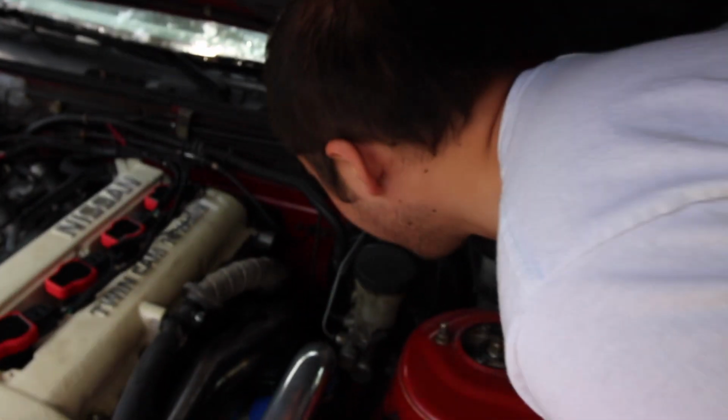So I'm racing this FRS and I'm only getting like 5 to 7 pounds and he's pulling on me. I'm supposed to be at 19 pounds and I'm like, that's not right. Then I heard a little ting ting ting and something fell out. I tried boosting a couple times, tried resetting my gauge, and then got to where I was going and popped the hood and saw that. Are you kidding me? Just like my wastegate.